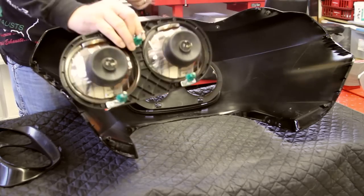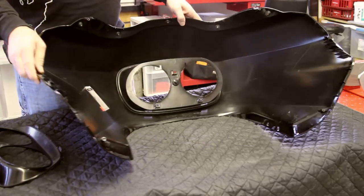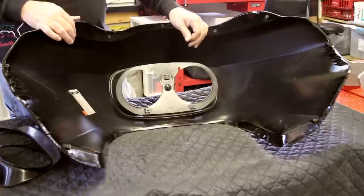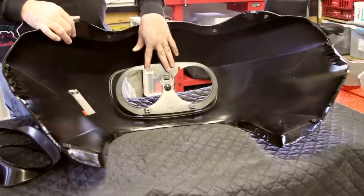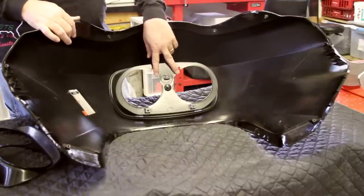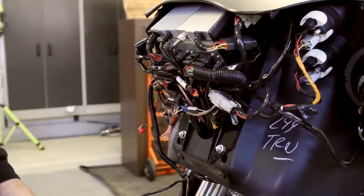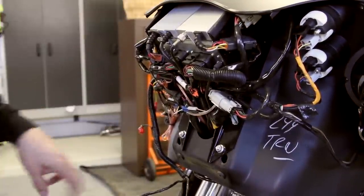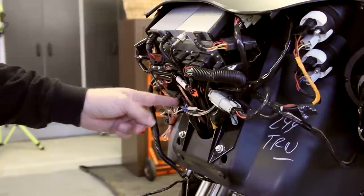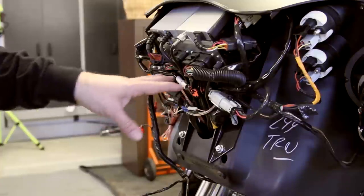The reason it's important to take the bezel off is that it reveals the two hanging points — one, two — that fix to the frame of the motorcycle. The fixed fairing mounting points on the fairing, for receiving the inside of the fairing, start right here. This is really important because now you can find these two spots quite easily on the motorcycle.